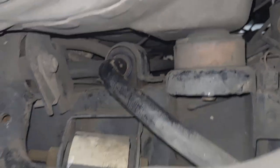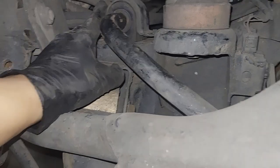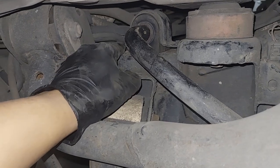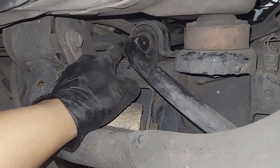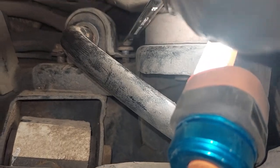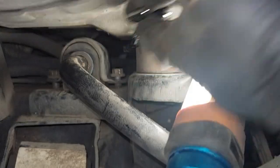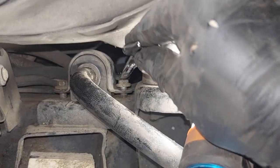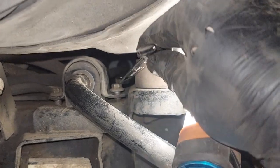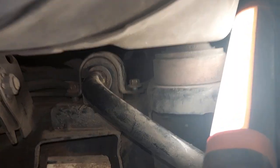I've managed to get the new one in and lined up on either side. Now the next step is to put the bolt in and push it down. For the rear one it's 62 Newton metre torque. I'll see if I can fit my torque wrench, but if not I'll estimate. I've lined up the bolts on both sides and I'm now tightening them with the 13mm spanner. Unfortunately I don't have a ratchet spanner so it's time consuming — I need to use this small spanner and maybe turn it 100 times to get it to a depth where I can then insert the ratchet to tighten the bolt.